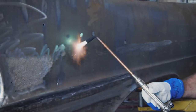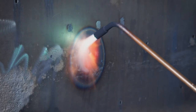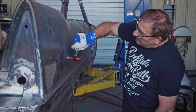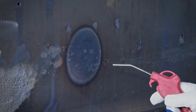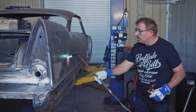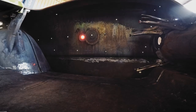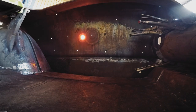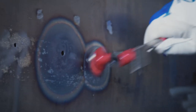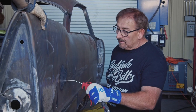Try to get that area red. There it goes, getting red now. In this case it was really soft through there. I had to take the torch and get it nice and hot glowing so those molecules are moving around, then hit it with the cold air. When you do that, it shrinks it back up again. Once that thing is actually shrunk down to where you can't push on it — you can see it gets a little more solid each time — it won't grow again. See how stiff that's getting? It doesn't flex like it did.